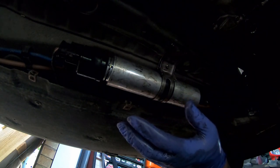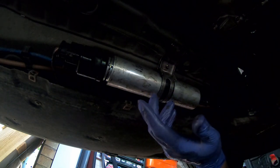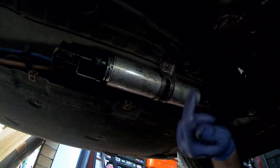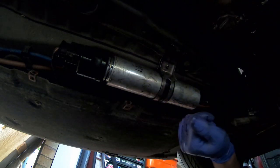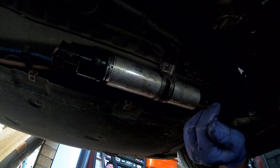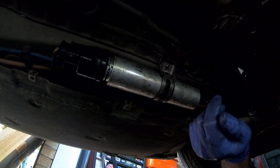The only point to make with this is when I try and start the car it may take a little while before it fires, because there is no fuel in the filter. The lift pump in the tank has got to push fuel through the filter first and then we should be good. I'll get the undertrays back on and then I'll bring it back.